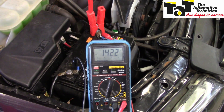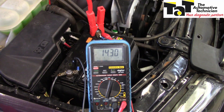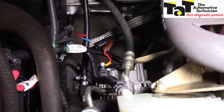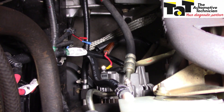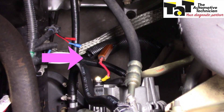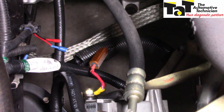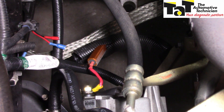Look at that — we're heading back to where we belong: 14.2 volts in this particular case. So we now have full voltage here instead of a voltage drop. If you are curious about what the actual fault is — if we zoom in there a little bit — I've actually installed a one-ohm resistor in the output wire going back to the battery, just for testing purposes only.